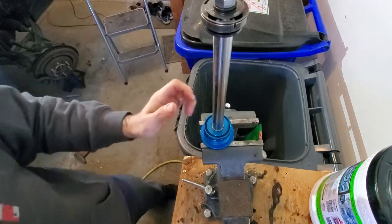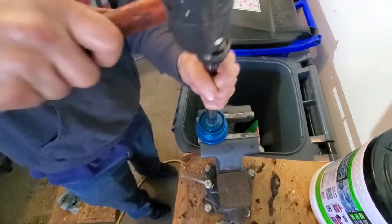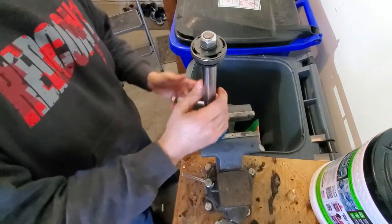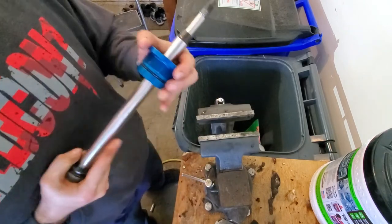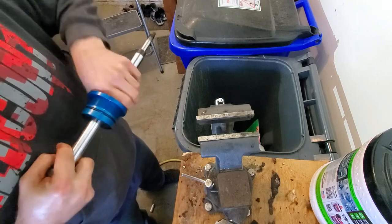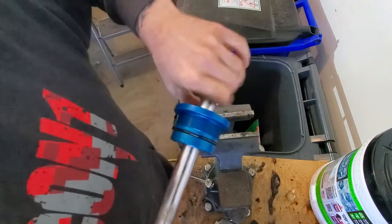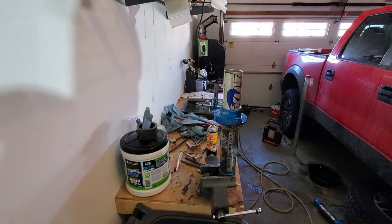Take your top cap, force it down as far as you can, then take it over to the vise. Set the cap on top of it like that, and on the end of this nut just give it a little tap. Once you get it on, just kind of make sure it slides freely — that'll tell you your O-rings didn't get bent over or pushed.